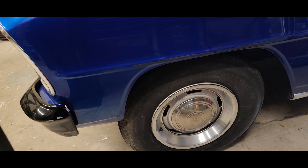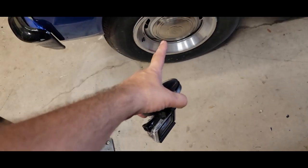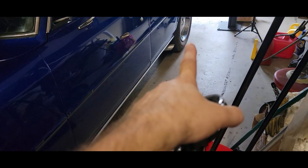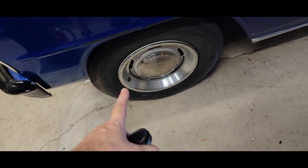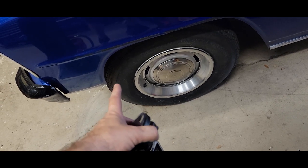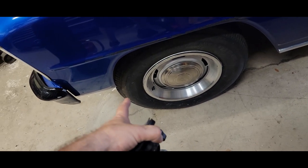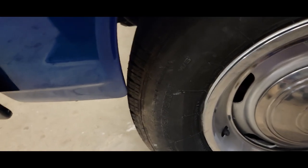So those are all the things, and then, you know, we painted the wheels. They were white. Now they're on here. The tires, I need different tires. These are ancient old anyways. Them suckers are expensive as crap, but I'm going to have to get new tires. These are 215-75s. I think we need to run 205-60s. Would look good. People recommend 205-60s because you can see how close that tire is to rubbing now that I towed it in. When you turn and hit a bump, if you're in the middle of a turn, it's going to bump. A 205-60 will take care of that.